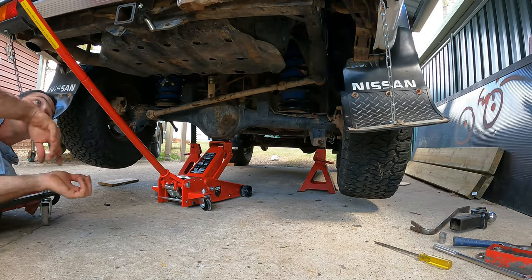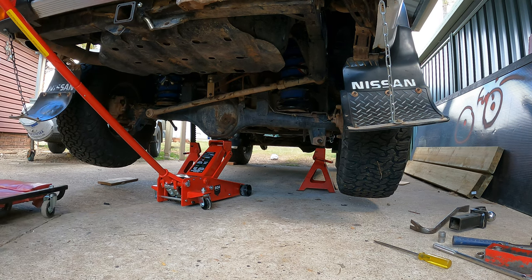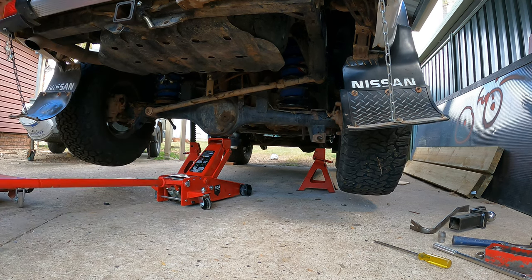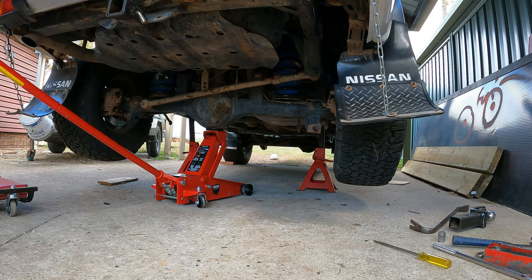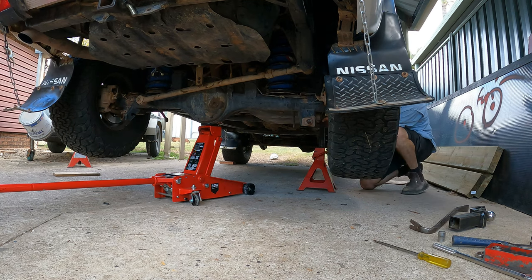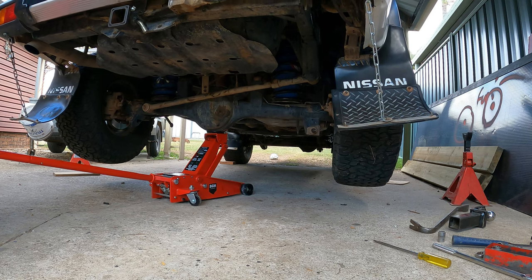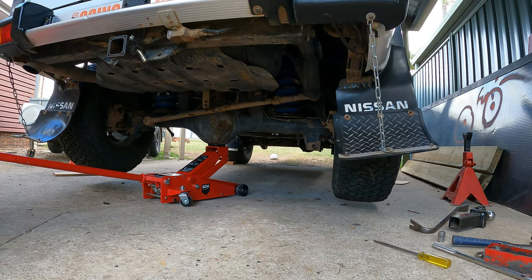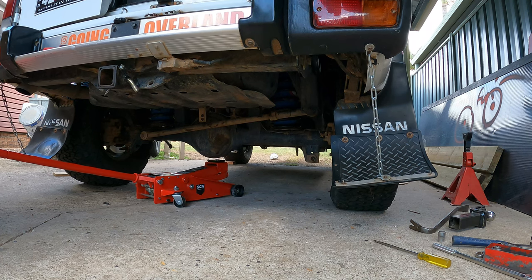All right, that's pretty much everything on as far as the airbags go. All done. So I'm going to jack up the axle, remove the jack stands, lower the car, take those coil compressors out, put the shocks back in and the sway bars back on, put some air in these airbags and take it for a test drive.